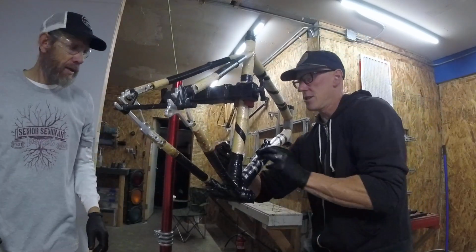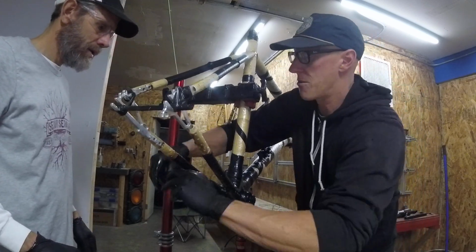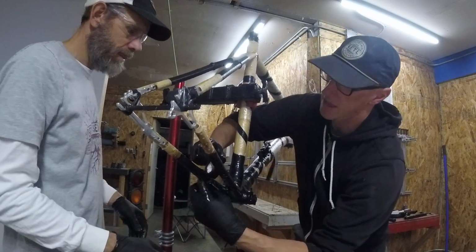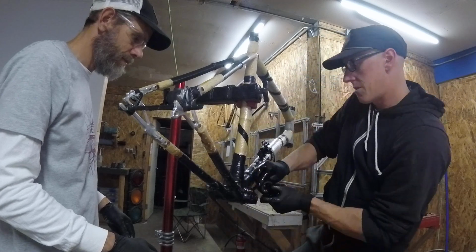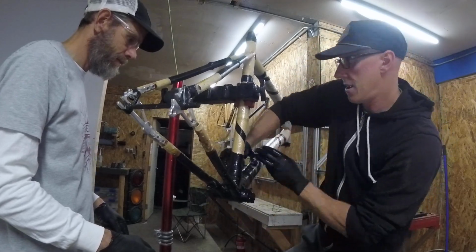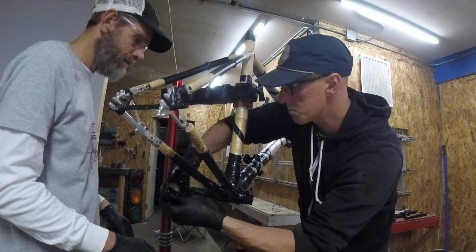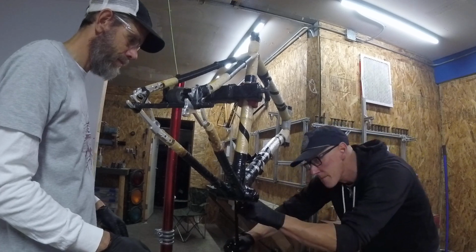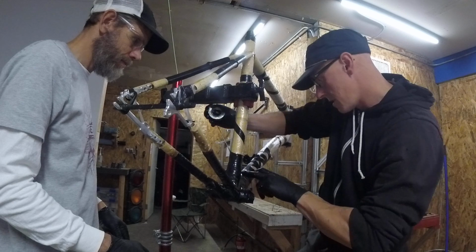So this one's really about taking a pass. If you go under the bottom bracket in a long spiral, that'll get you where you want to go, and then you can come back on the inside and manage that wrinkle and then come back under the bottom bracket. Do the same thing again in a different spot. Sometimes you gotta go super low, sometimes you gotta go inside, sometimes outside, sometimes you gotta go to the top again.